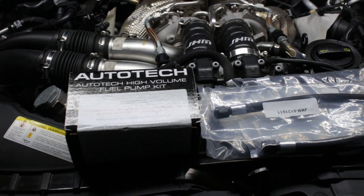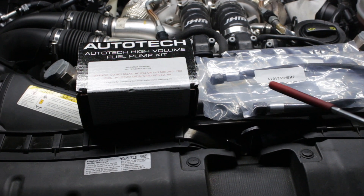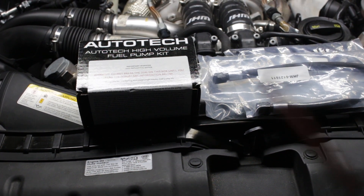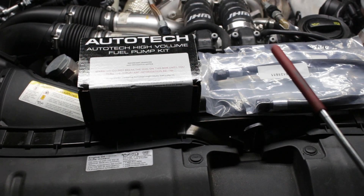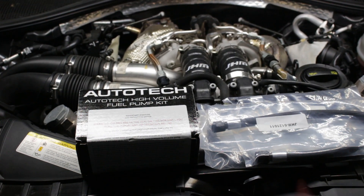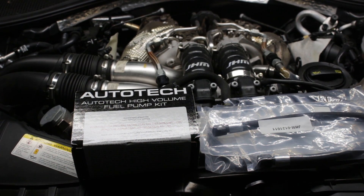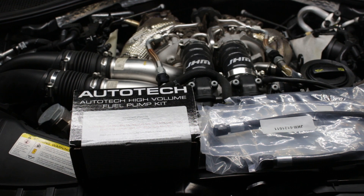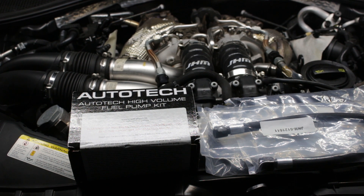As I dug a little bit deeper, I realized that one of the biggest issues with these cars when you're going to try to push it is going to be your fuel system. The S6 and S7 all have a smaller fuel controller and don't put out as much fuel. On the RS7s, you're not immune either. That's why we're changing out the low pressure fuel feed to high pressure units and throwing in an Autotech high pressure fuel pump upgrade.